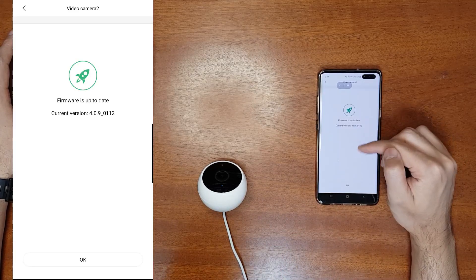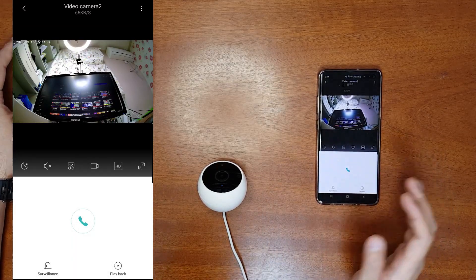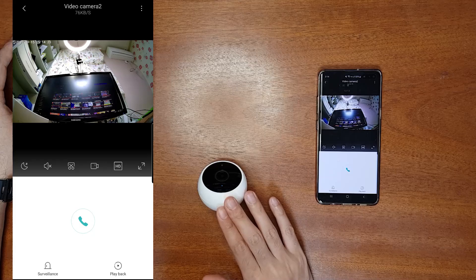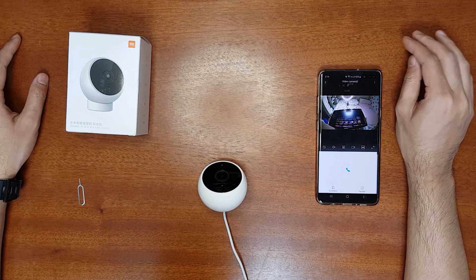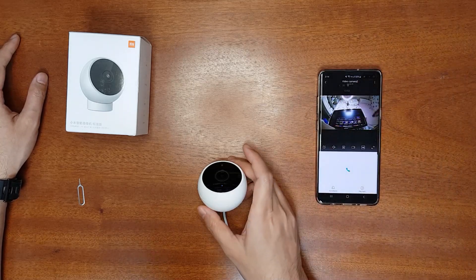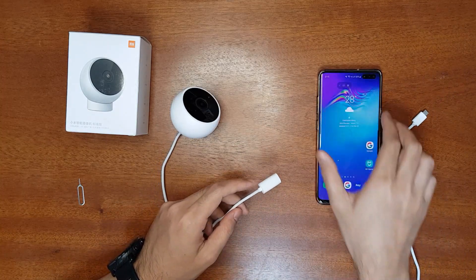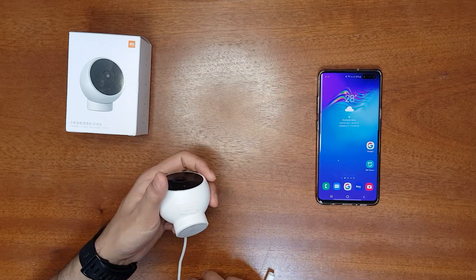Since this is connected to a server near my location, the notifications and surveillance recording will also be better. Currently there are no firmware updates even in the new server. So that is the partial solution for the problems this camera faces — the surveillance issue and the playback issue. But if your current firmware still has problems with playback in always record mode, you need to downgrade the firmware. To do that, you need a computer with a micro SD card reader. First turn off the camera, and you also need a SIM ejector tool — remove the micro SD card.